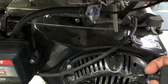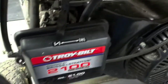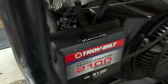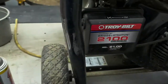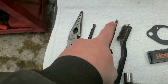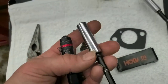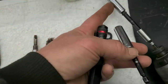Carburetor looks like it's definitely seen better days. To do everything in this video — check out and clean the carburetor — you're only going to need a couple things. You're basically going to need a screwdriver, something that'll fit in the main jet — the width needs to not be too wide. Some old-school Craftsman screwdrivers won't work. You'll need a couple sockets — you can use regular ones, but I like the deep wells: 10 millimeter and an 8 or 5/16ths.